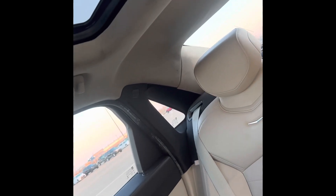When I first did this I took apart everything because I didn't know. Because most cars you have to move the headliner down. But actually, I didn't have to remove the headliner to get to that back sunshade — I could have just moved the glass out. So they did give you that access. But the reason why they put the sunroof motor back behind under the headliner in that spot, I have no idea. Even if I move the glass, there's still no way to actually get to the sunroof motor, because it's still under the headliner regardless. If I move the glass I will be able to see it, but I wouldn't be able to put any tool in there to get to it.